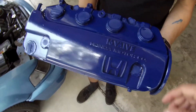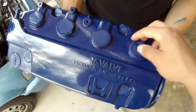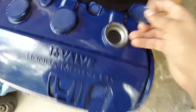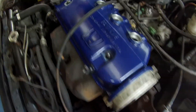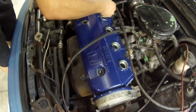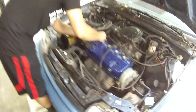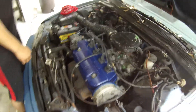All right, got done painting it — looks really good. Just some little spots here and there but still good. We're gonna start peeling this stuff off, putting the seals in, and then putting it back together. This Honda is officially hot boy. We got all the seals in and put the old spark plugs back in so whenever we run seafoam we can throw some new ones in after that. Going ahead and starting it up.